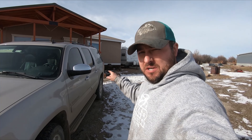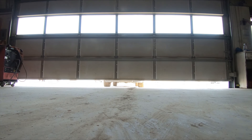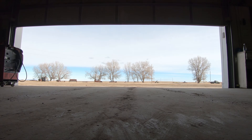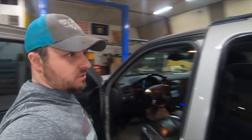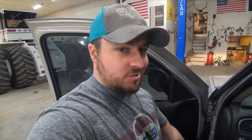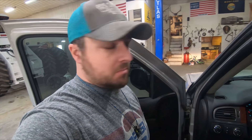I need to grab my wife's vehicle — her window is not rolling down and I need to figure out why. It's probably a wire that's cut, pinched, or worn through. The other windows work but the driver's window doesn't. When I opened the door at one point it started working, so that kind of tells me there's something to do with the wiring in between the door jamb. I'm going to try to pop off the rubber and see if I can see a broken wire. I almost guarantee that's the issue.